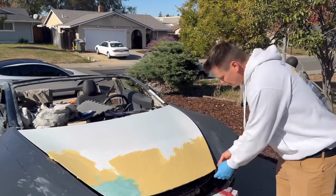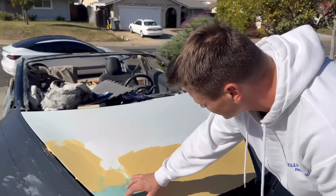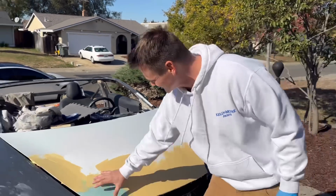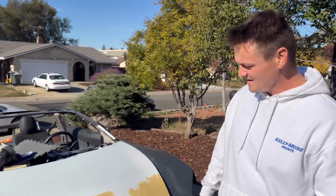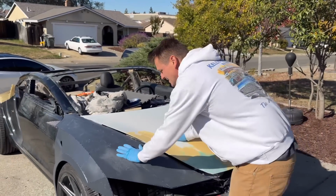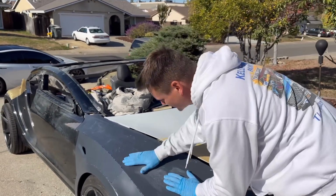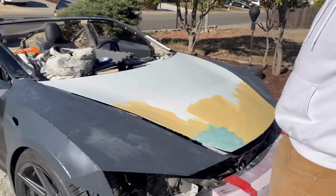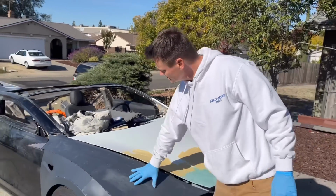I just put a nice thin layer of this 3M platinum putty right here, and then I was trying to finish this part right here, but it was drying up too quick with the sun, even though it's cold right now. All right, right now it doesn't feel as tacky as it did earlier. I'm gonna sand down the top piece, right? Cover this thing with the fiberglass body filler. Good.